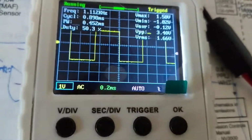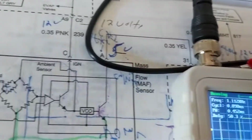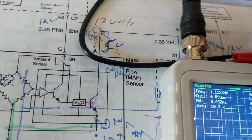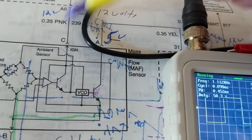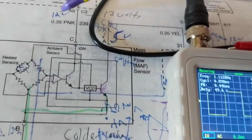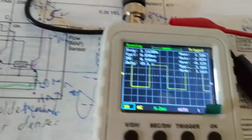There's no choice. Like I just said in so many previous videos, electronics is tough in automotive because it has to be done with the car on. You cannot take the connector out. Some people go in and take out the connector. This is 12 volts, like we just discussed. Take out the connector, 12 volts. Oh, it's good. What does that prove to me? Put it plugged in. Put the connector that goes to this, the pink wire, all 3 wires. Then measure how much. Maybe this is loading down the circuit.